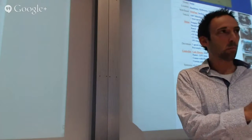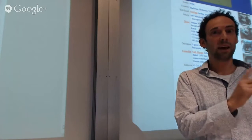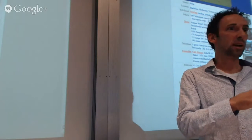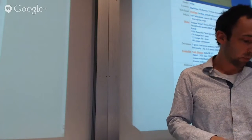So ideally, you would find your VAS engineer, or talk to a few of them perhaps. Consider donor cars, and once you've selected one, go back and talk to your VAS engineer to check they're happy with that car as a base in terms of what you want to do with it. Work out your battery layout. Are you going to cut a hole out of the back seat and weld the box in? Are you going to mount boxes like I did and bolt them into the boot and the bonnet? And then talk to your VAS engineer again about that, because that's about weight distribution. It's about what you're doing to the chassis in terms of cutting, drilling, bolting.